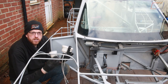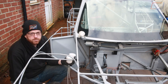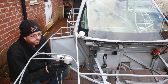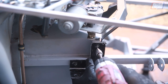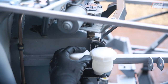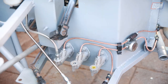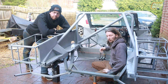The last thing we're going to add to our hydraulic system today are the reservoirs. The clutch one we're mounting on top of the master cylinder exactly as per the design from the OBP pedal box. These two brake reservoirs, however, have to move because the extension we made for the throttle pedal means they no longer fit comfortably on top of the master cylinders. So we've repurposed a bracket we got off the TT — it had all the holes in roughly the right places — and made up a little bracket that holds the reservoirs on the side, connected with these two lines which OBP sell as remote reservoir lines so you can lift them up out of the bottom of the car and they're a lot easier to see.